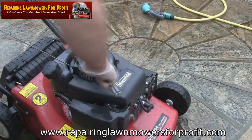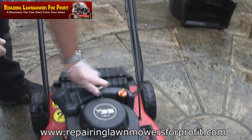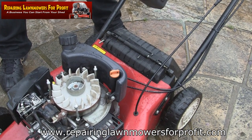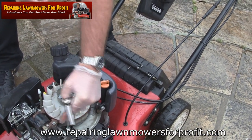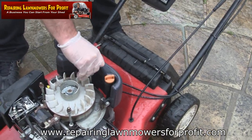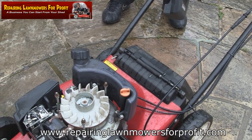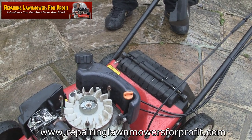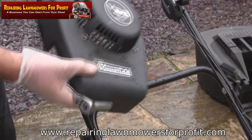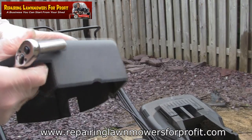These are really easy to get off — we'll just take these three parts off and lift it off. Just take all these and slack them off. Just lift that off there like that. I like to put these parts back on here so I know where they are so they don't get lost — easy to find after. Some of these are different; this one's hooked in here so I'll have to use a spanner on here as well. Have to back this right out to get this cord out. We can pull this out and clamp it from the other side and cut it off, then put a new pull cord on as I've shown in previous videos.